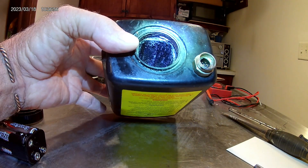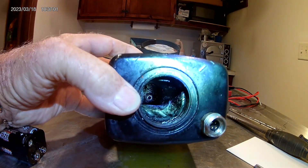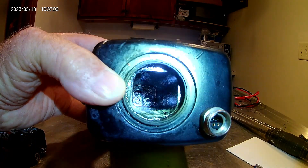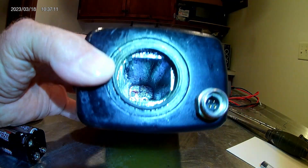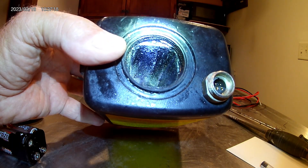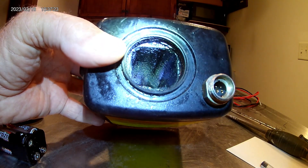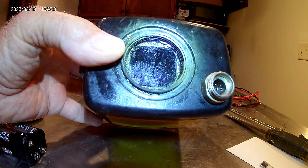We're going to take that screw out because I put it back together, but as you can see the one spring in there is not exactly lined up like it should be — that's because I had to re-bend it to make it work. I'm not sure if it's contacting the actual battery terminal, but the only way to check is to take the unit back apart and see if I get 12 volts into the power line, because it still does not come on.